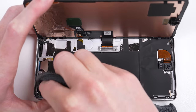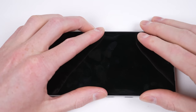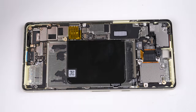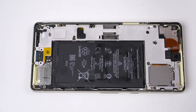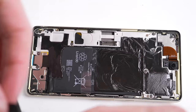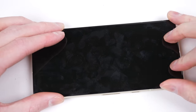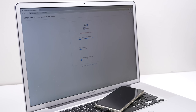After I clean off the insides with a microfiber cloth, I can close up the display and latch it back into the frame. After reinstalling the SIM card tray, it's time to get the other phone reassembled. And just like that, we've now assembled the cream Pixel 7. Upon swapping the parts back, I had to recalibrate the display again to bring back fingerprint functionality.